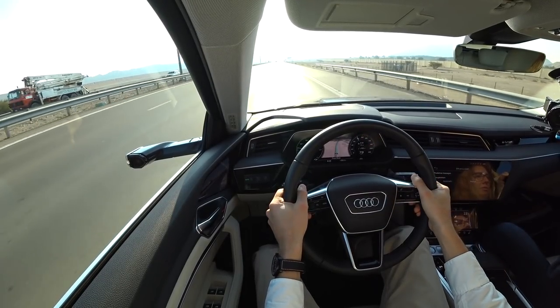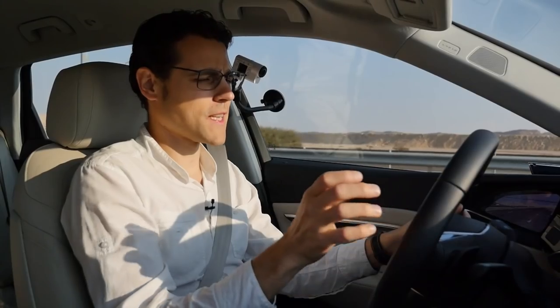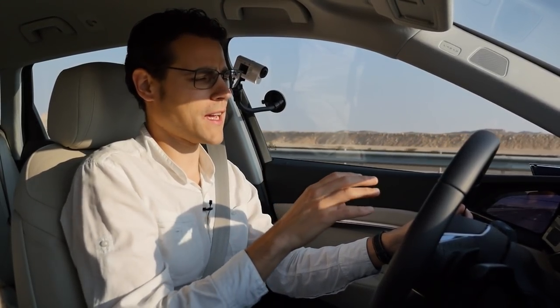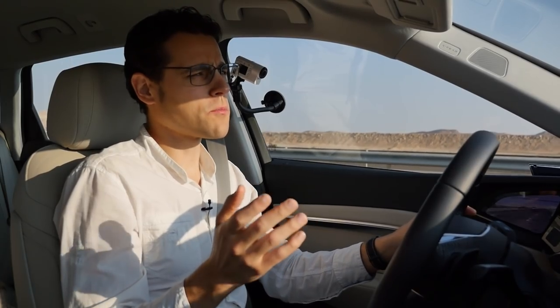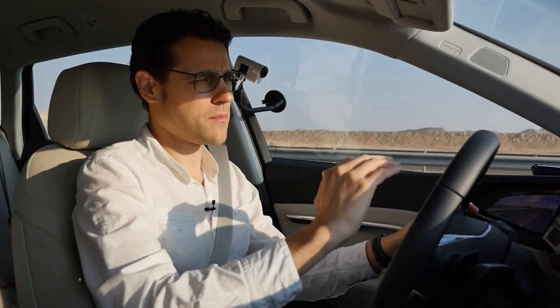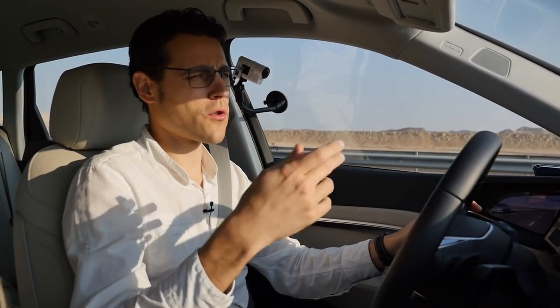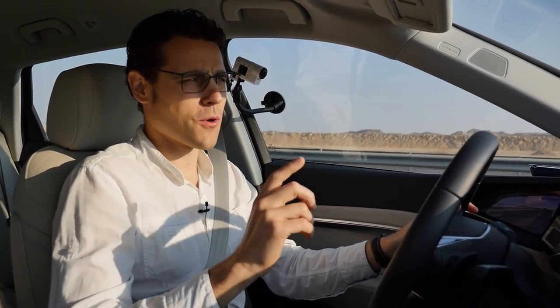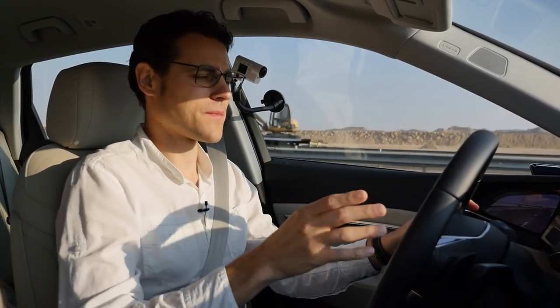However, if I now, on the infotainment system, pick manual, then it's more like, you know, from Tesla, for example, like this one pedal feeling, because then the car is remembering what I said on a manual basis. I can have it with just rolling here. Nothing's happening, car's just rolling, which would be more efficient if I want to roll the longest way, of course. So rolling is always more efficient than recuperating, unless you want to reduce the speed anyway, and that's quite often the case.